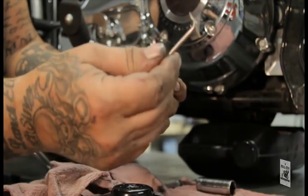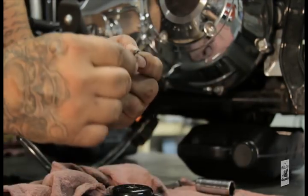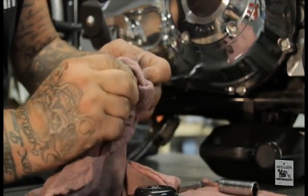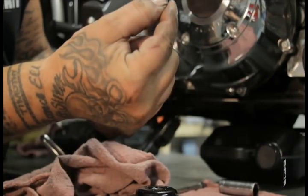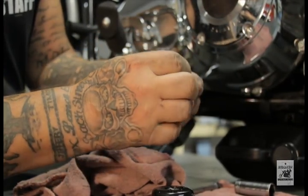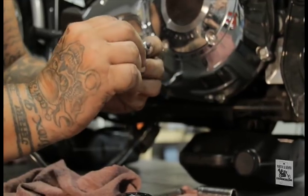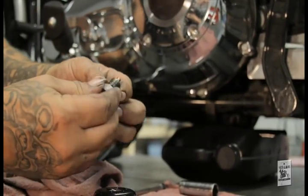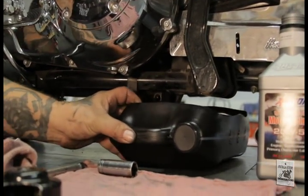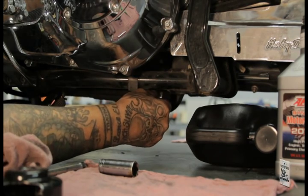There's an O-ring — take a pick and remove the old O-ring and discard it. Check your threads to make sure there's nothing on them. Install your new O-ring; there's a chamfer in there that it'll sit right in, so all you have to do is roll it to the bottom and it will sit in place. Once you've done this and see you have no issues or debris, slide your oil pan out of your way and reinstall the drain plug.